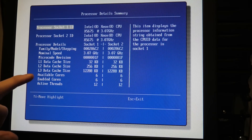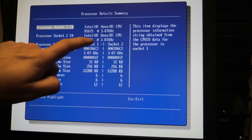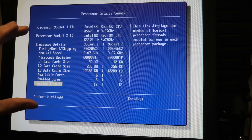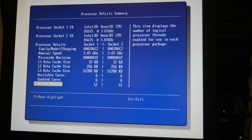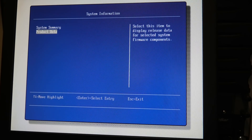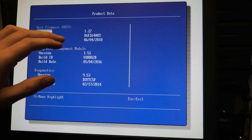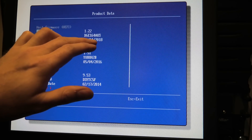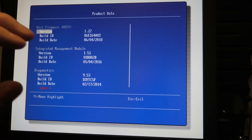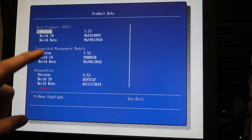The X5675 at 3.07 gigahertz - good CPUs, the fastest 95-watt TDP CPUs on Intel's list. For the server to support these X5600 CPUs you need to make sure the firmware is not too old. This firmware is from 2018, integrated management from 2016 - this is new enough. We know that because it already recognizes the X5675. So we're good to go; we can shut this server down.